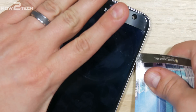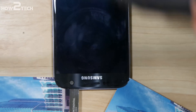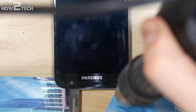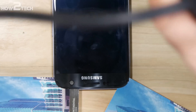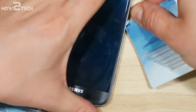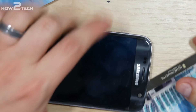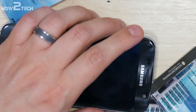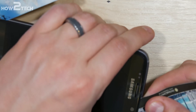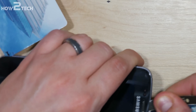Use just the tiniest bit of the tip and go down the side of the display, making sure you only get the bezel of the display, working it back and forth. Do this on both sides before you remove the display so you do not break it. Remove all the adhesive off the top of the display, going over the earpiece speaker grill right on top of the AMOLED. The AMOLED is adhered into the midframe of the phone. The key point is to remove all the adhesive around the outside of the display — remove the adhesive from underneath the AMOLED so we can pull it open without cracking the AMOLED itself. It is extremely fragile and this is a very hard process.